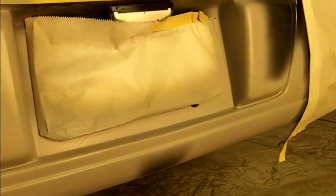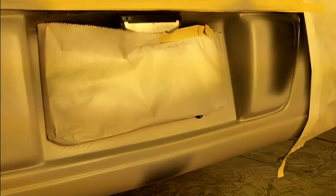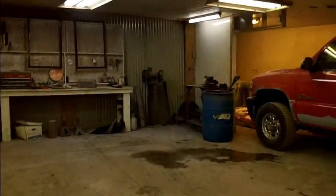Another couple minutes, and I'm going to put another coat of primer on this, giving it about 10 minutes flash off. It is about 70 in here, so that's good. I've got a little accelerator in my high build primer to hopefully let it dry. So that's it for today, guys. I'm going to put my 2 more coats on this, and I'll get this uploaded for you. So hope you're having a good day, and thanks for watching.